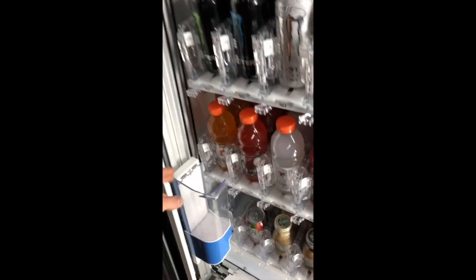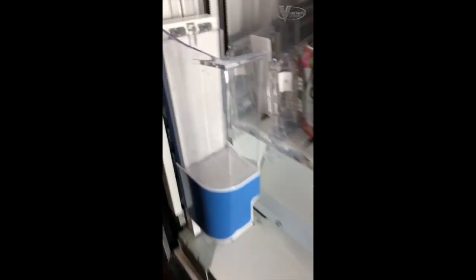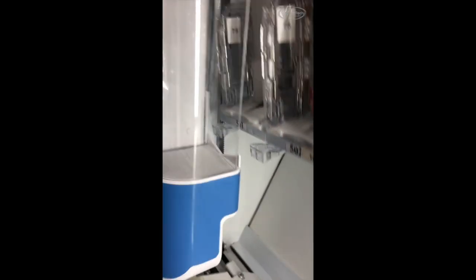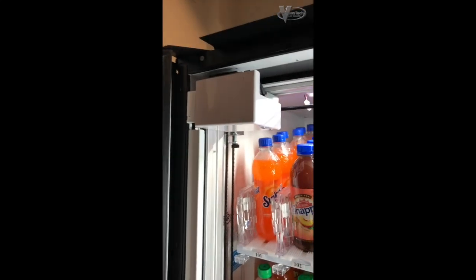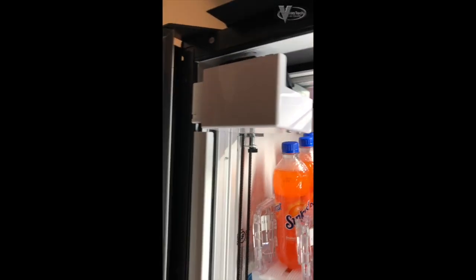And one other thing I'm going to mention real fast that we did fix — the plunger on this cup, even though we put a brand new cup on here, it was coming out and kind of getting stuck in the out position, and then slowly coming back in. That was really puzzling me for a minute when I first got here, because I wasn't quite sure what would cause that except a bad picker cup, or maybe power voltage or something like that — the voltage from the transformer. It just ended up being that the Y motor board up here was very corroded all over the place, and a bad Y motor board can cause a lot of problems. So I replaced that and the Y motor board harness, and I totally fixed that problem.